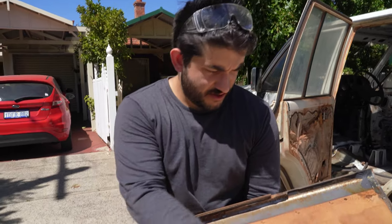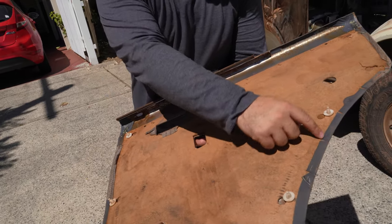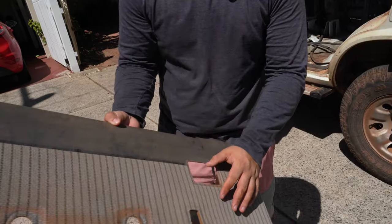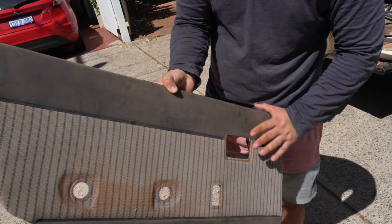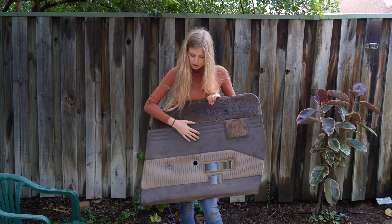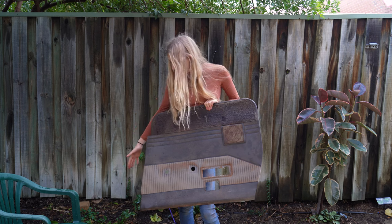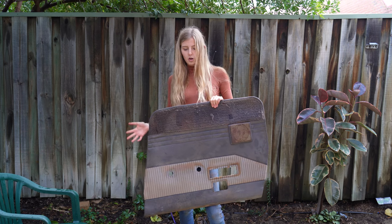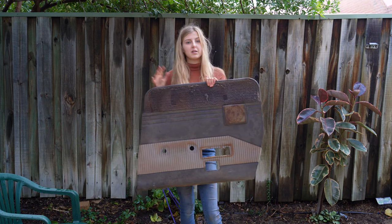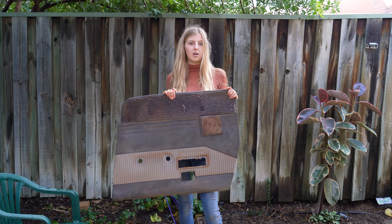We'll probably cut new cardboard backing but use the same outer edges, the same steel, same fittings, and the fabric — because this one's in really good nick, it'll clean up nicely. These vinyl, carpet, and fabric covers for the door cards need cleaning — they're covered in red dirt. It's going to be a lot easier to do that while they're still on the card. We want to do it while they're on the old card because we don't want to water damage the new card, so we're going to do that now before we actually peel this vinyl off.